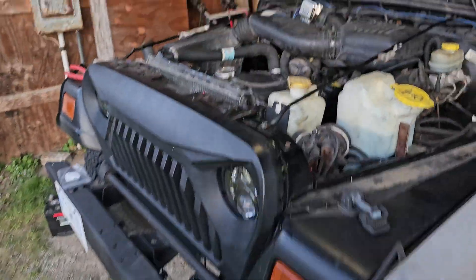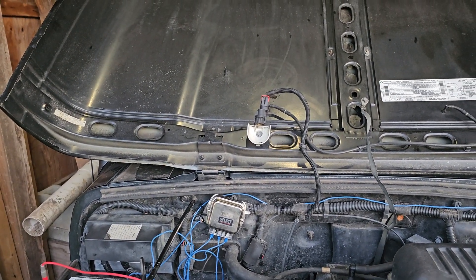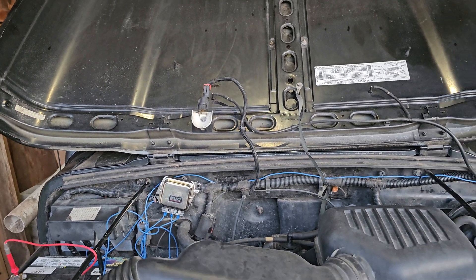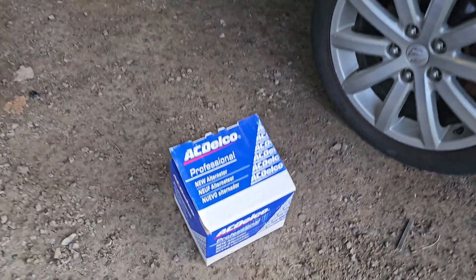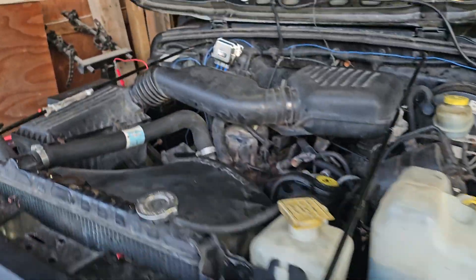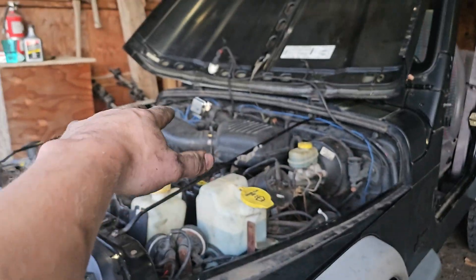The other field wire needs to be grounded. That little regulator ensures you don't overcharge your system — because if you just connect ground and positive without it, you'll overcharge and start cooking things. The 'A' on the R400 goes to the large power wire at the back of the alternator, and that same large wire also runs straight to your battery.